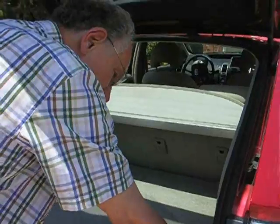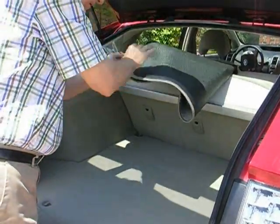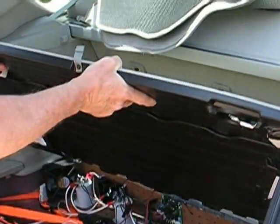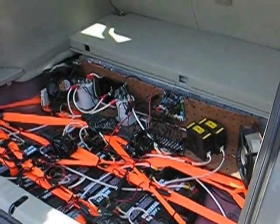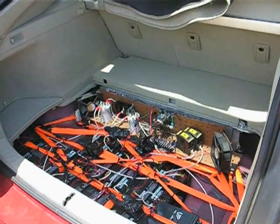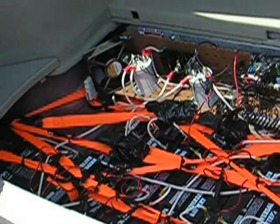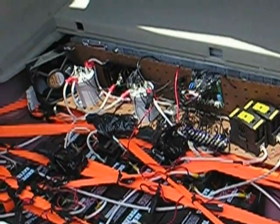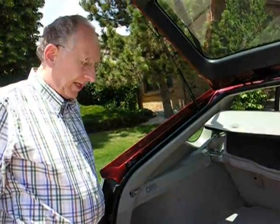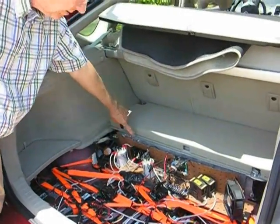You can't tell at this point that anything has been done, but Toyota left a little extra room underneath here in the back where we could add extra batteries and other items — I believe Toyota has done this on their plug-ins. I used sealed lead acid batteries. I could have used lithium ion, but that's quite expensive, and I could have also used nickel metal hydride, but lead acid was the cheapest way for me to go. It cost me six hundred and fifty dollars for the lead acid batteries and a hundred dollars for shipment.